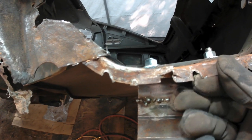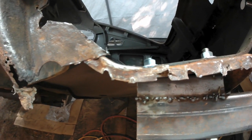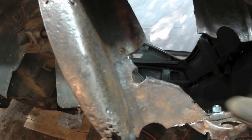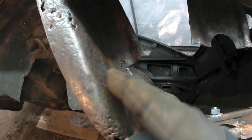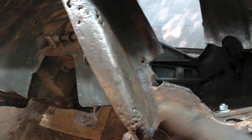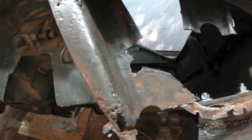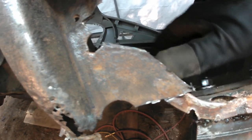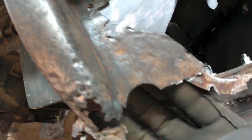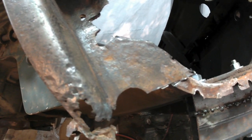This is that torn apart as I try to pull those spot welds out. This is a little bit odd looking up here, but I didn't want to cut in this way and try to keep this reference curve as long as I can. The metal back here on this part of the trunk floor is actually pretty good, as is the flange on the other side here. I don't have enough light to show you, but please take my word for it.